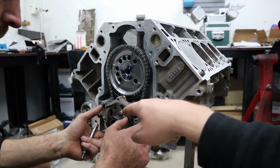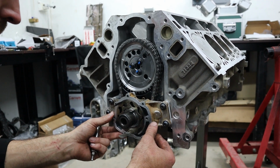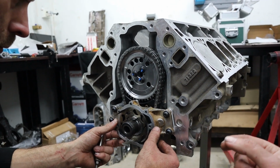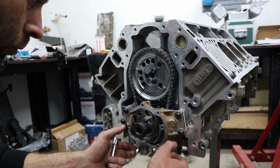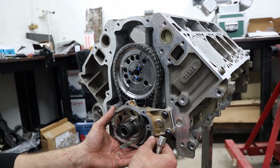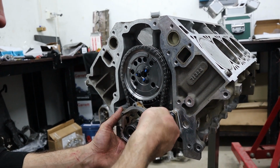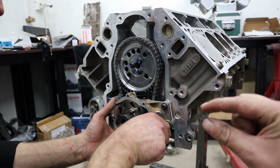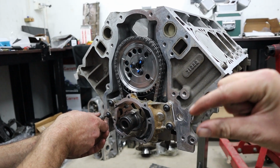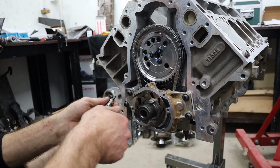These shims go on the inside of the inside gear, as you can see there, and to the outside gear of the pump. What these ensure is that there is adequate room the whole way around the gears, around the pump housing. What can happen is if you have the pump hard one way, you can have it hard against the gears on one side, and this is going to mean that there's no clearance to have your oil film around the gear on that side of the pump, and it's going to be wearing at the pump housing. It's going to cause all sorts of problems.